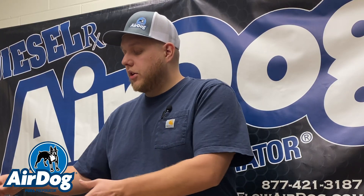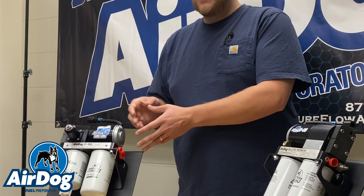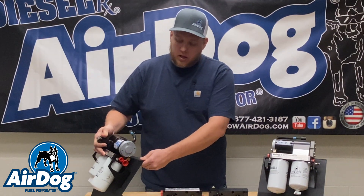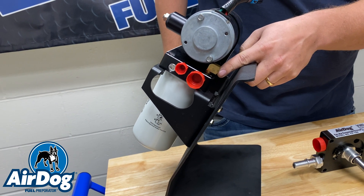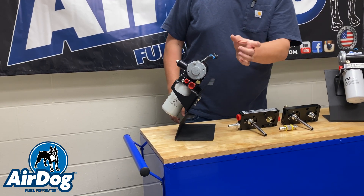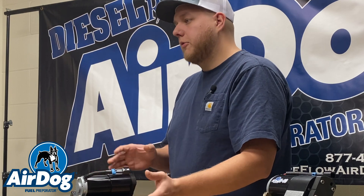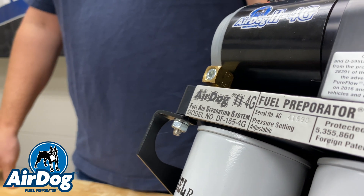On your 5G-style units, you're going to notice the diaphragm regulator off the side of the tower. The fuel pressure port is going to be on the opposite side. So if you're looking at your diaphragm regulator here, just directly on the other side — we can kind of move it and show you here — there's going to be a brass elbow, just as the 4G had. You can tap for your fuel pressure directly. Note that on our display it looks like there's a little bit of clearance issues; we're not using our spacer block on this display stand. Standardly you're going to have about a 2-inch spacer block, so it will give you plenty of room regardless if it's mounting towards the frame rail or the inside of the frame rail. You'll always have room for a gauge or a sending unit.